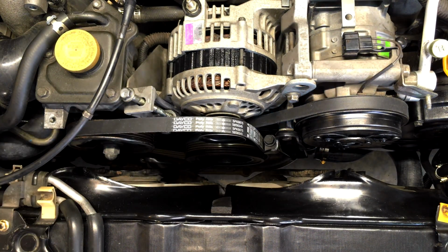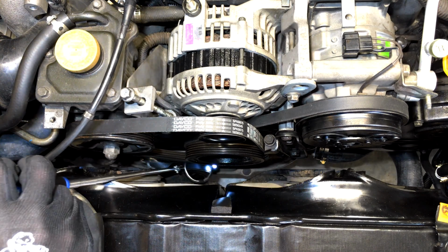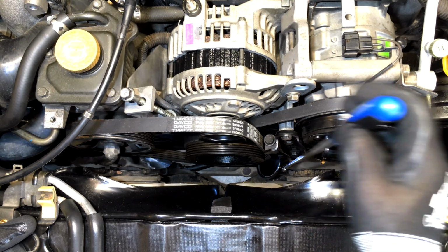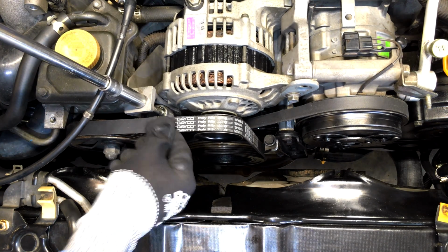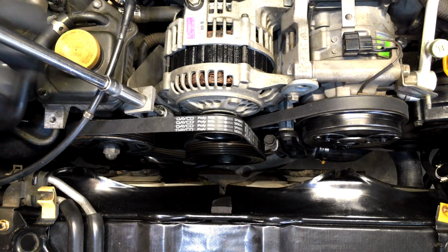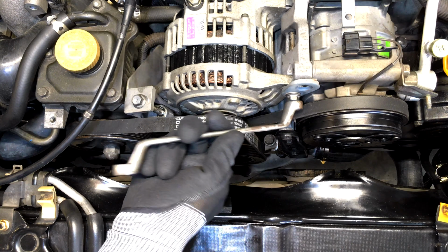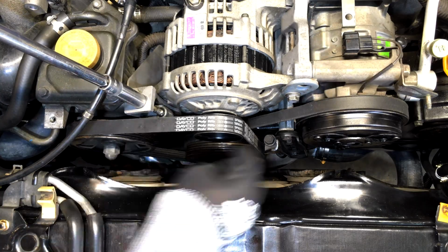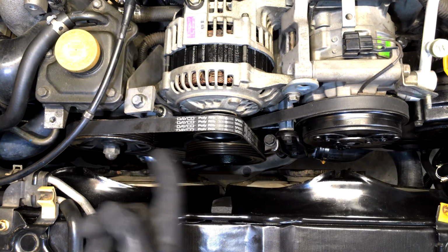Okay. Also check it's seated. Yep, looks good. So we can start running the tensioner up on the alternator. Now this tension does change a bit when you lock the pivot bolt up, so we're going to tighten it up a little more now. So just tighten it up and then back it off a smidge, like that. Better chance of getting our tension right. Alright, now we tighten up all our pivots and pinch bolts.